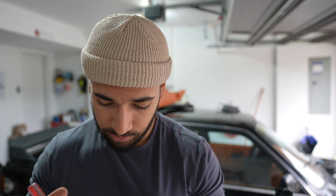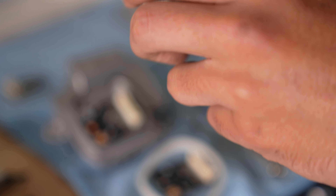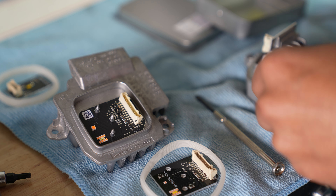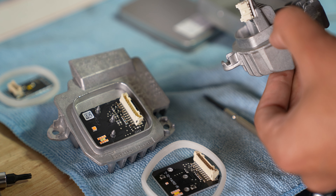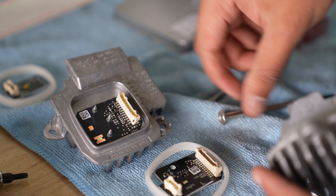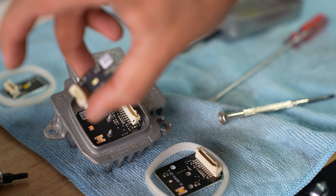Just two screws right up here at the top — very simple. Same as the bottom one, there's a wire connecting to the module itself; disconnect it and you should be good to go. These are the modules out of the left side of the vehicle. To remove the actual modules from the housing, it's better if you warm it up just a tad so the heat sink adhesive can loosen up. I'm removing the rubber grommet piece first so I don't damage it while heating.